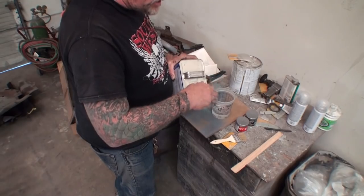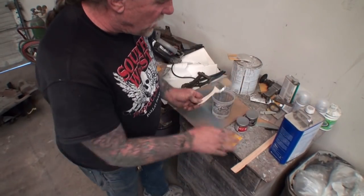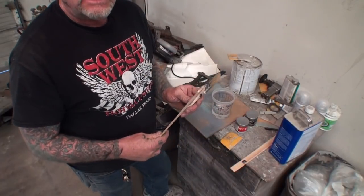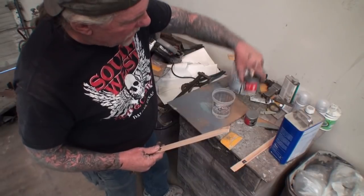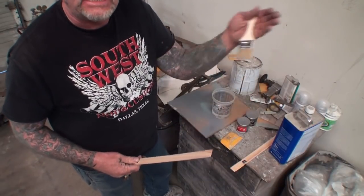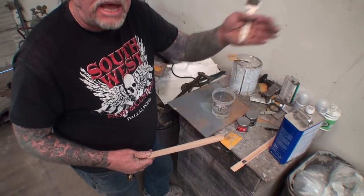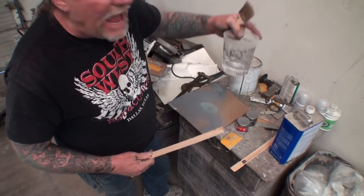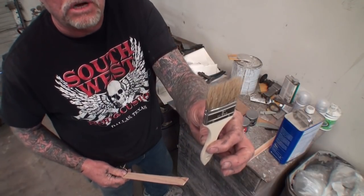And what the acetone is used for is smoothing it out. We're going to take the brush and our paint stick, and once we apply our PC7 epoxy paste to the rusted out area, we will smooth it all out and make it look professional using our acetone, our paint stick, and our throwaway brush.